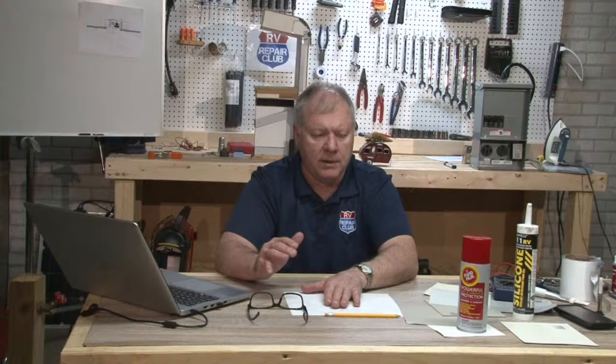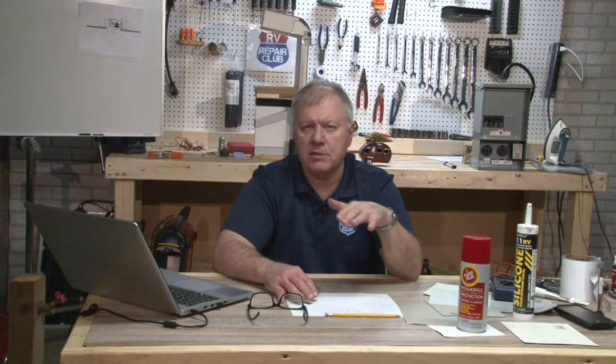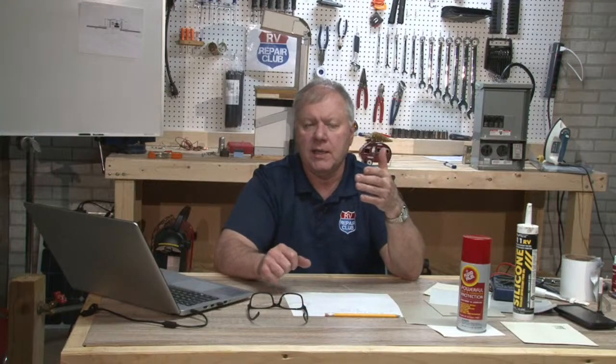There's a company out in the market called the RV Safety and Education Foundation that has been weighing coaches for probably about 30 years now. And still they're finding that almost 50% of the RVs out in the market are overloaded or have underinflated tires in some capacity. It might not be overall, it might be just the front or just the back. Anytime you put maximum weight or go over maximum weight, you're really taxing that chassis system and that suspension to make it perform the way it was designed to.